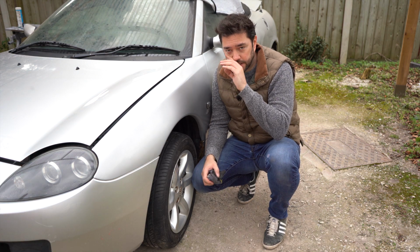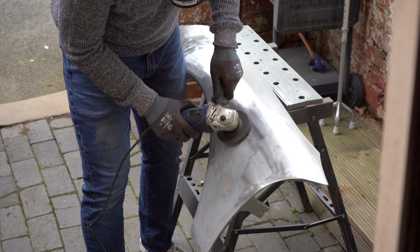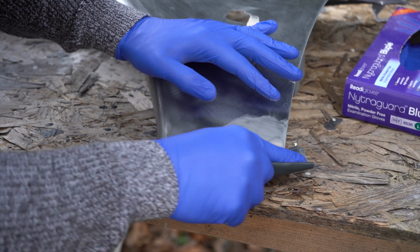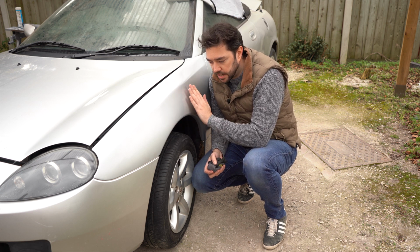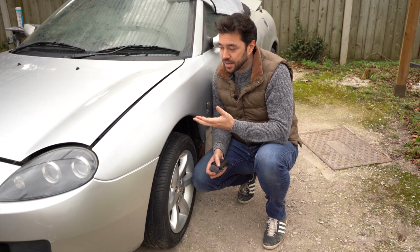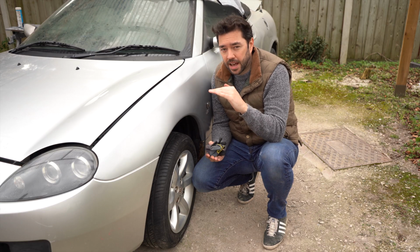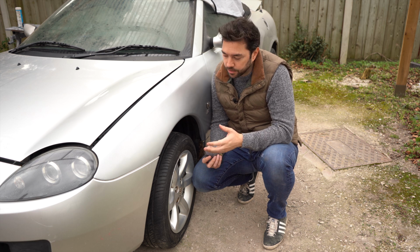Now on the other side, I did something slightly different. Because I did the other panel first, I could see the outline of where I'd made the repairs. So with this panel, I ground it all back, sanded it all back to bare metal, the whole panel. I treated the areas that were pitted due to the rust, sanded them back, and then went over the whole thing with paint. Now, I'm much more pleased with the consistency of this panel. It's really flat, really smooth. Great. I wish that had happened on the other side. But I ran out of paint. As you can probably tell, it has a bit of a dappled, speckled grey kind of feel to it. So I ran out of paint like an idiot. It takes one full can to do 3 decent coats, and I started this panel with about 2/3 of a can, so that's on me.